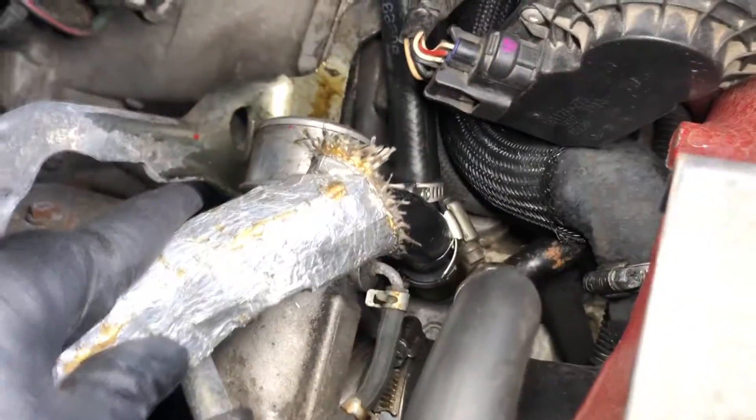The top one goes to the front, right here. The first one goes into the intercooler. This one here goes to the PCV port. This one right here goes right above the turbo. This one over here goes right into the coolant, and then the last one goes back into the PCV port.